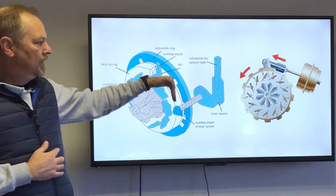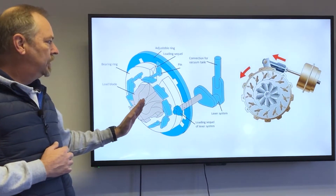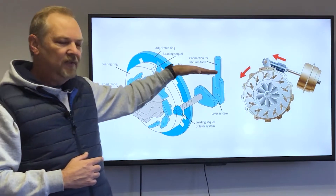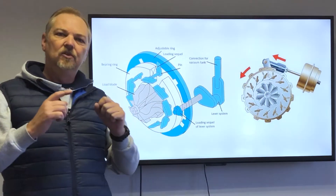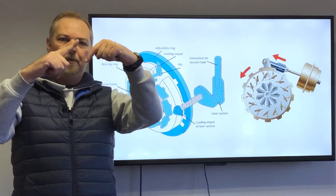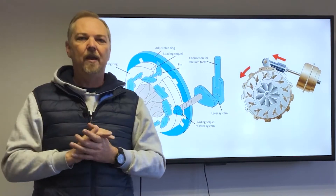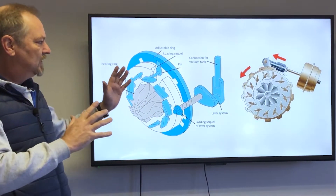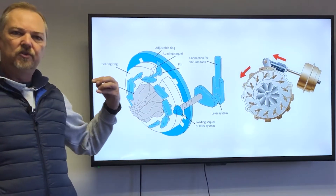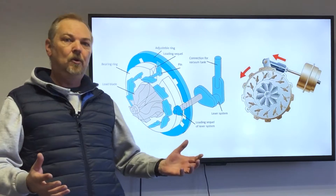The designers wanted the turbo to reach its revs very quickly and then plateau into a very stable RPM — rather than fluctuating like the old turbos. To achieve that, as exhaust gas flow increases they start to open up the linkages, much like you open your lips when blowing on that fan. This gives us a fantastically simple and very reliable system that produces torque from the turbo at very low RPM, largely eradicating the problem of turbo lag.